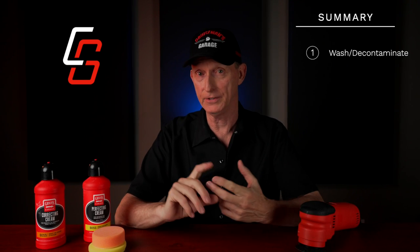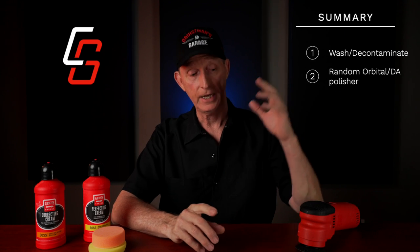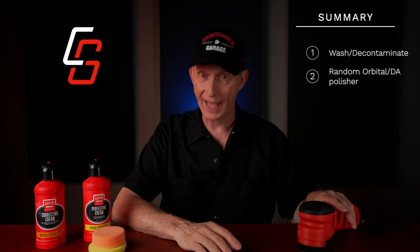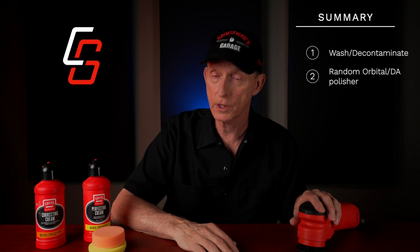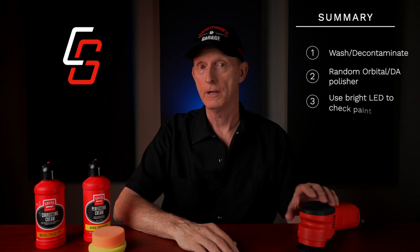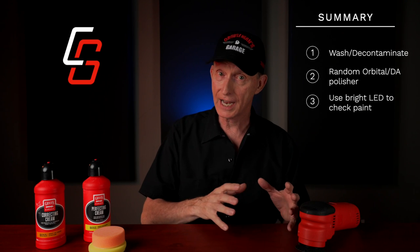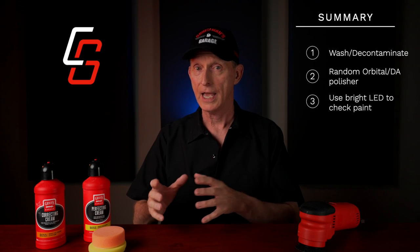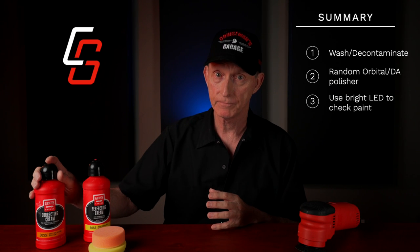So, let's summarize what we've learned. Wash and decontaminate the surface before machine polishing. Use a random orbital or dual action polisher like the one I use from Griot's Garage with a 3-inch pad. Check your paint using a bright LED for those areas that have heavy scratches or damage and will require the use of a compound like the correcting cream.